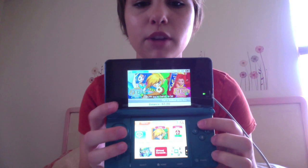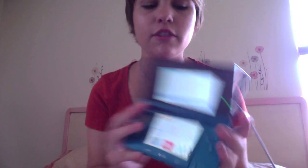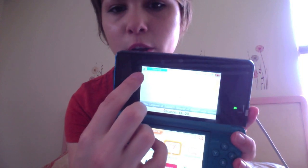All right, it's connected. I'm connected to the store and everything. I can browse around and all that good stuff. And then it says in the corner 'internet' and my little signal bars are going. So I'm connected to the internet, and this is just by opening up my system and jiggling the WiFi wire that's connected to that card — just reposition it. If it does disconnect from the little WiFi card, you can snap it back on really easily. Just put your system back together — screw the panels back, make sure everything's in place including the battery — then turn it on and connect to WiFi. You're done. It's a really easy fix.